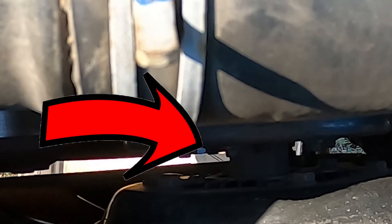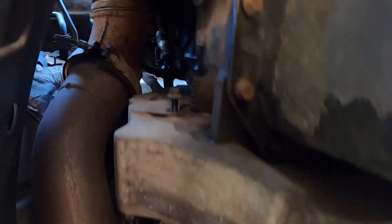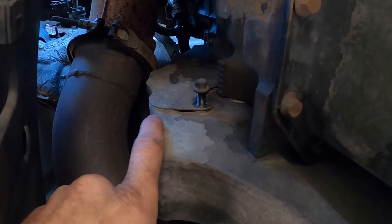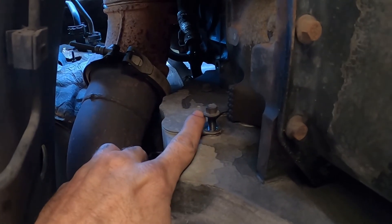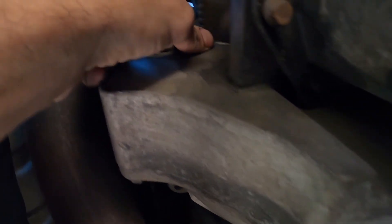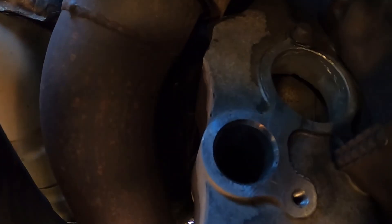The white mark is top dead center right now. If you're going to use the barring tool, get under the truck on the passenger side. On the plate where the engine and transmission mount — on the opposite side of the starter — there are two 10mm bolts. One holds it and the other is a slip-on, and that hole is where your barring tool goes.